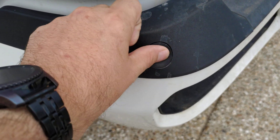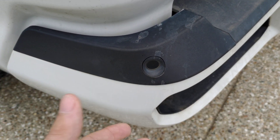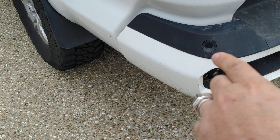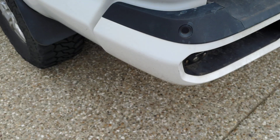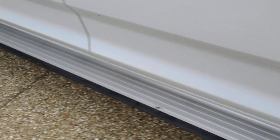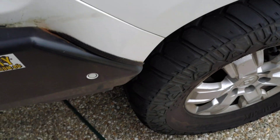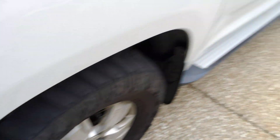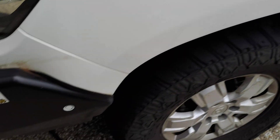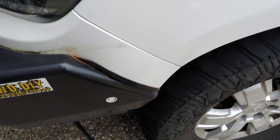How these work is they send out a little radar or radio wave to pick up that something's there. As something passes the back of your car, it gets picked up by that rear one because the reflection off the car bounces back and gets picked up. It won't turn off until the car passes all the way up your side and is picked up by this one. I've also noticed that sometimes a motorcycle will fit perfectly out to the side and the blind spot will still go off.